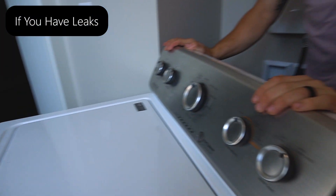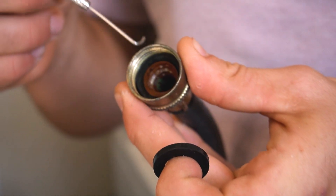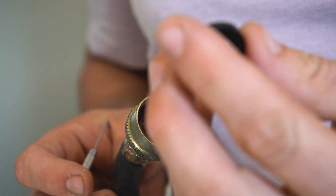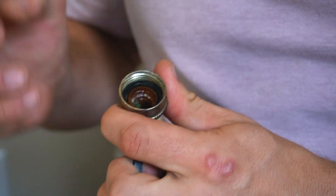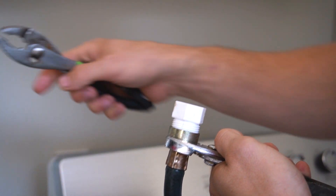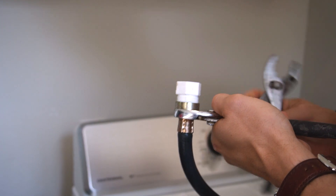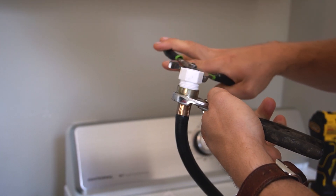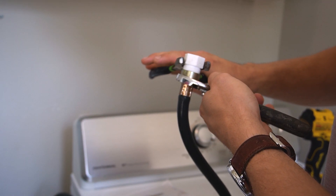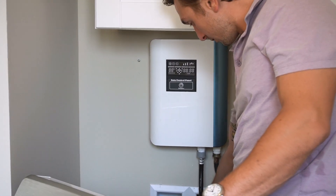Next I'm going to check for leaks by turning the water back on. It did leak a little bit on the tubing connected into the machine, so this gasket needs to be replaced — you might need a new rubber hose gasket. You can either pull the old one out and put a new one in, or just put the new one right on top. I also took the plastic fitting off the ozone machine and am tightening it a little more, using two pliers. Be cautious of over-tightening — you don't want to over-tighten this.